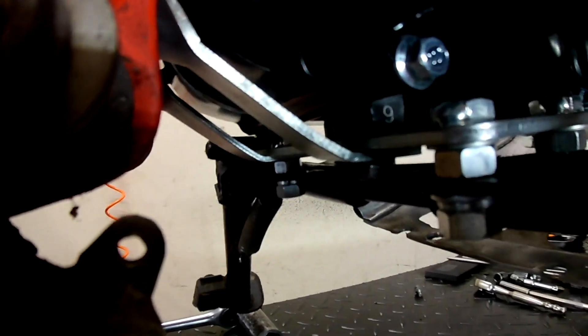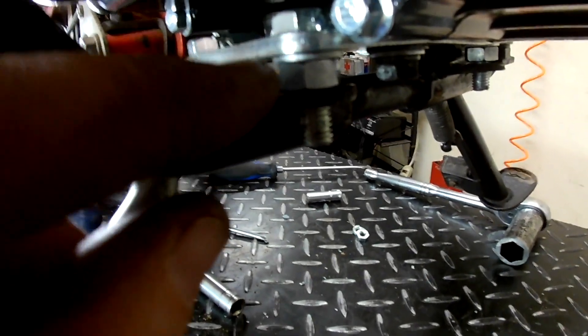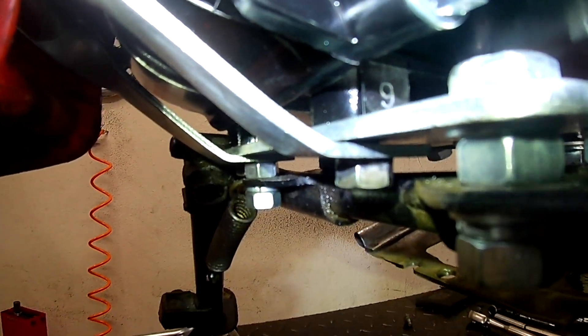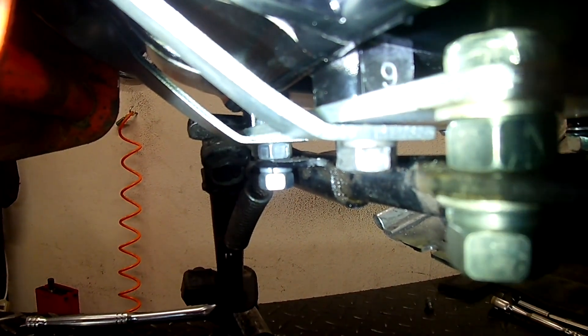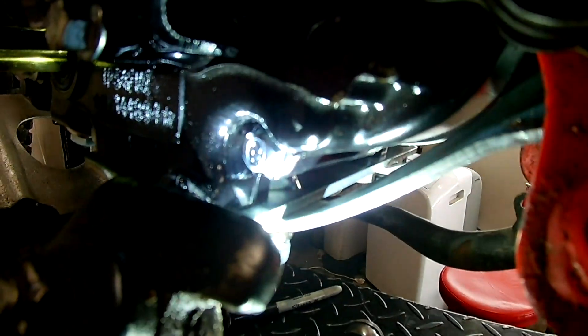To make this bracket work — this adapter plate — you have to screw the plate onto the engine first. Then I put a nut and a washer right here on this one and a nut and a washer on this one. This bracket right here goes to this engine bolt, so the bracket plate gets sandwiched between this bracket and the bolt. On the other side I've got the bracket the same way, but it's not on the engine mount bolt — it's on the stud next to it.